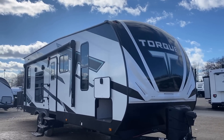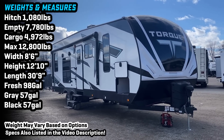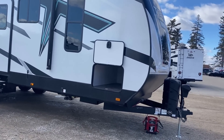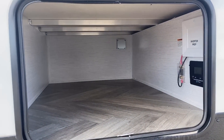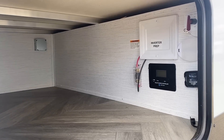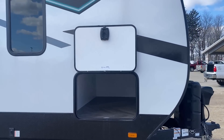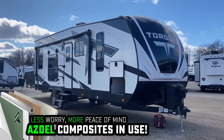I will try to look up links to the Apple and Android app stores for that — if I forget, leave me a note that says 'hey dummy, you forgot the links.' I frankly wouldn't take offense. If we start talking towing on this Torque travel trailer — a lot of alliteration going on — when you see a model number 26, half-ton towable thoughts start peeking into people's heads. There are plenty of places that will sell you this saying the dry weight is less than your half-ton pickup's tow capacity. But what you need to look at is the GVW on this — it's made to accept a hefty load, with 12,800 pounds of gross vehicle weight. With the body width and height of this thing, there's no way I would personally handle this with a half-ton.